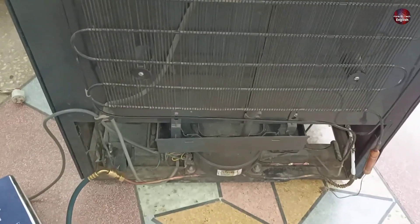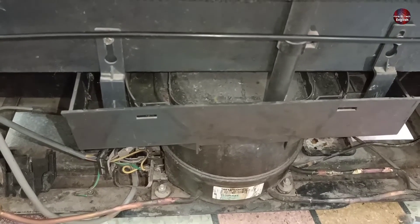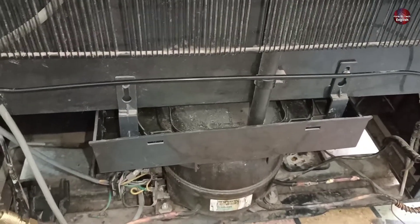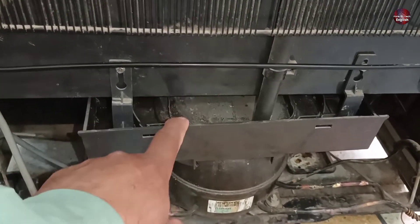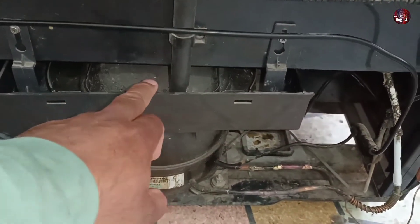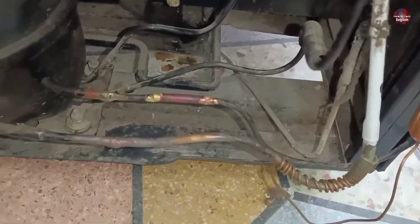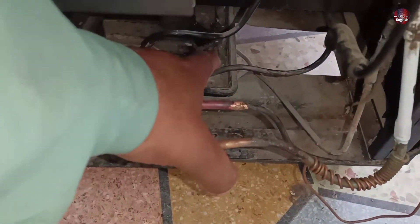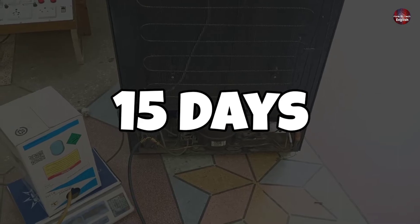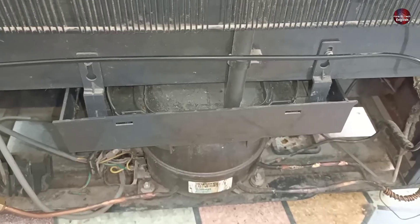The drip tray of the refrigerator could be the cause of producing dengue. I have seen some videos on YouTube where people are telling to pour water inside the compressor tray to cool down the compressor. I must say that pouring water inside the drip tray is not recommended. This refrigerator has two trays, and when the first tray gets filled, the water flows toward the second tray beneath. The water evaporates mostly from the tray on the compressor. I suggest you clean the drip tray after every 15 days or whenever you have time, because pouring water inside the tray does not cool the heated compressor.